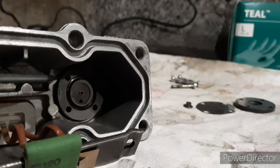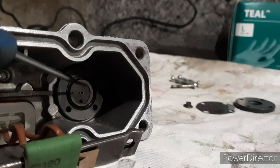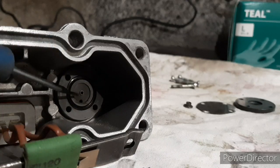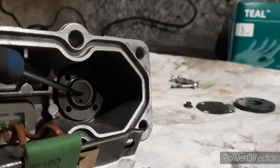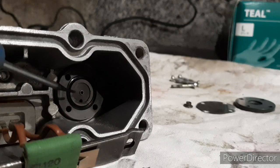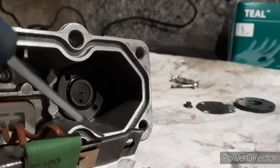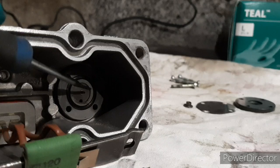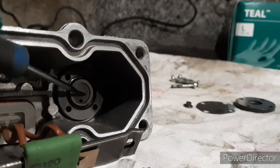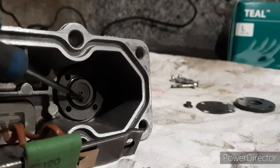You've got two little holes - a top one and a smaller one - and the middle port and outer are exactly the same height. In a cold start situation, there's no spring pressure on the disc, so normal fuel pressure is enough to lift that disc off its recess and let fuel bypass into that hole, which removes pressure from the control plunger. Once the car warms up and the bimetallic strip moves, it places pressure on the spring which pushes down on the disc, sealing that hole. You can test that by putting your finger over it and trying to blow through one of the holes at the other side.